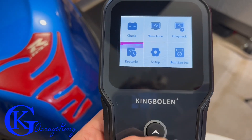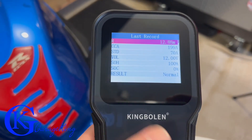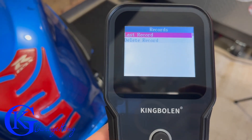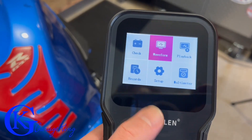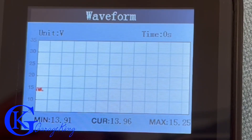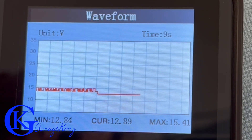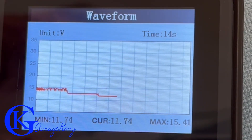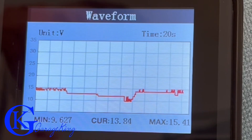Now we're going to go to records. I'm not sure if we have any records because we haven't really done anything — let's check it out. There's the last record, possibly from when I was using the multimeter. Now there's our playback and here's our waveform. We can see the waveform of the engine when it's actually running. I can shut the engine off and you'll see the voltage drop — you can see it's not running anymore. Now we're going to start it again, and there you can see the voltage is climbing because I started the engine, so the vehicle is charging again.